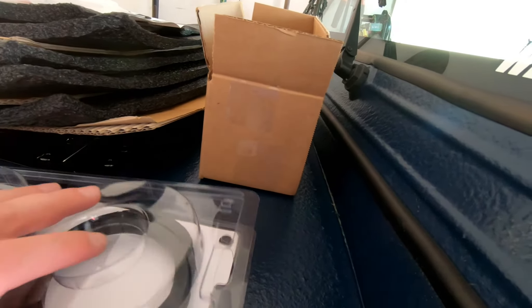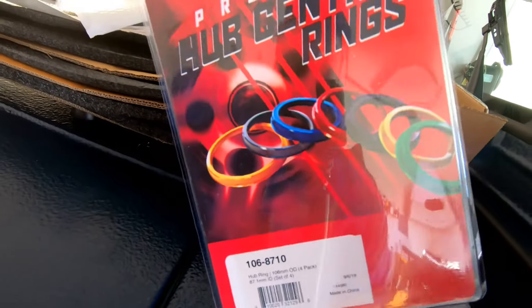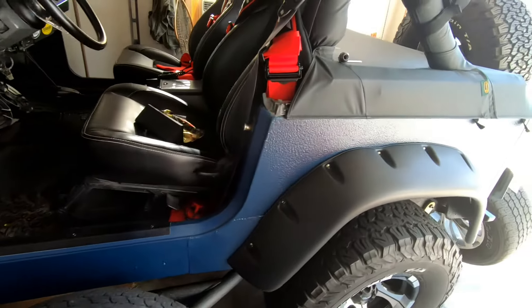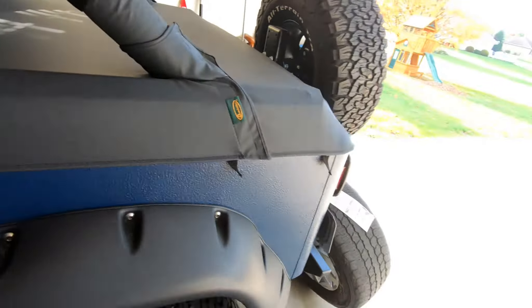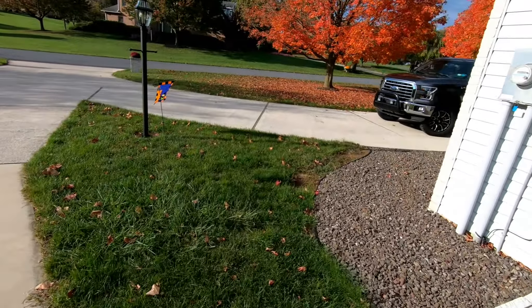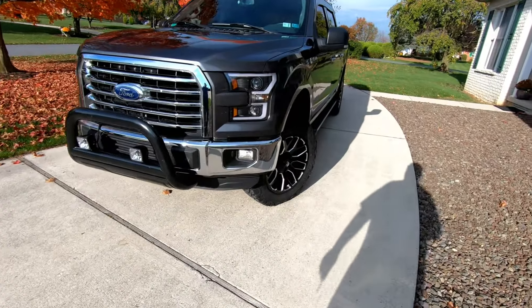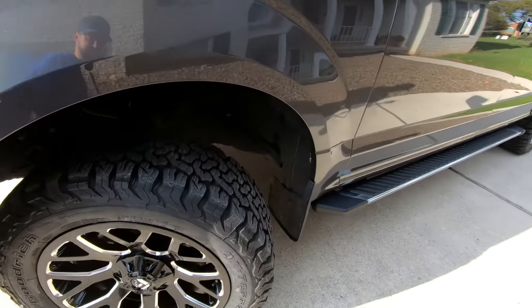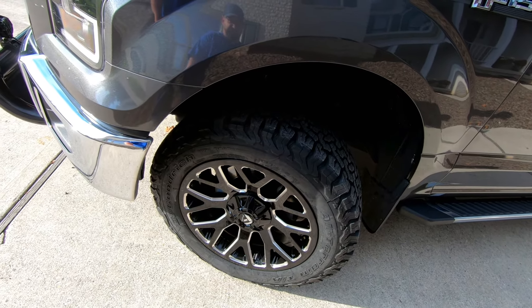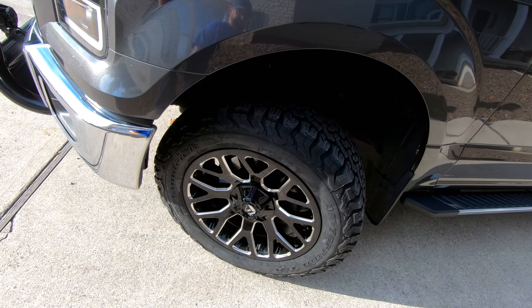The reason aftermarket wheel manufacturers make a universal style wheel is so that instead of retooling to make custom wheels every time, you can just use an adapter like a hub centric ring. When I ordered my new wheels from Custom Offsets, they came with hub centric rings already included. So on my truck we have a combination: a hub centric ring from Custom Offsets plus new conical lug nuts as well.